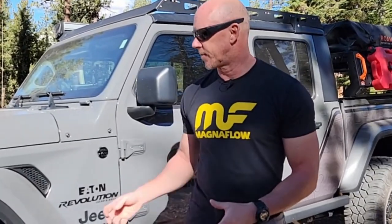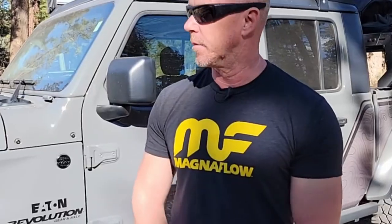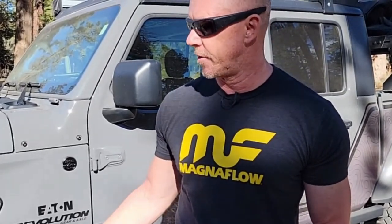Adding these gears has really given him highway ability, and off-roading — once he starts crawling — it's given him that lower range of rock crawling capability. With the lockers plugged into the stock switches of the Jeep, he can engage or disengage them at any time, and engage the front and rear separately — so if he needs to do a dig or just needs the rear, they're right there on the fly. Overall, he's loving it — getting the gas mileage back and his 8th gear back has been marvelous. They're also stepping up to some 38-inch tires soon and having that low gear ratio is really going to help.